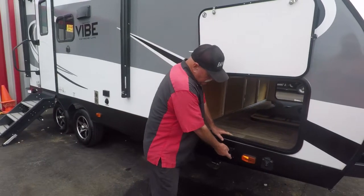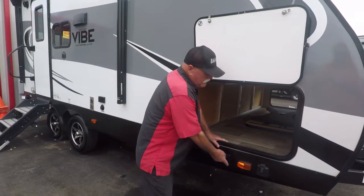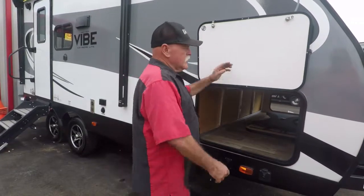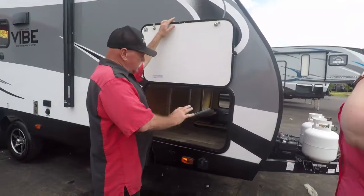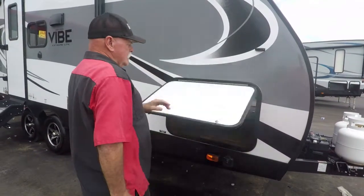You just press the retract button and it takes them right back up. Now one may go down and then the other may pop. Don't think there's something wrong, it's just the way they're designed. When they hit the ground, they snug down. That's all you do. It keeps it from rocking when you're inside walking around. Got it?